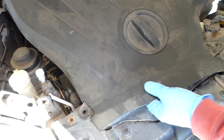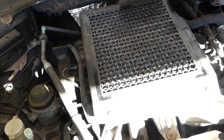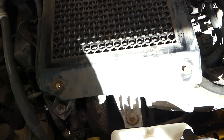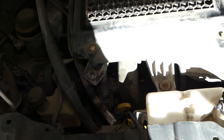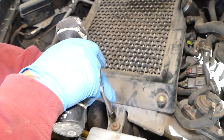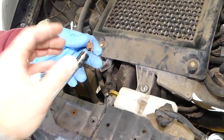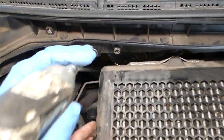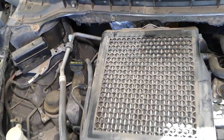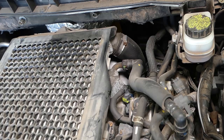You're supposed to have two clips here — some are missing. Just remove the clips and pull that cover out — the whole thing comes out. That's where your intercooler is. Whoever worked on it in the past lost a bolt, and there's also a missing nut right here on the intercooler. Use a 14 millimeter — and a 12 millimeter on this one on the back side. This one we'll have to do with a wrench. After that, disconnect the hose on this side and the hose on the other side as well.